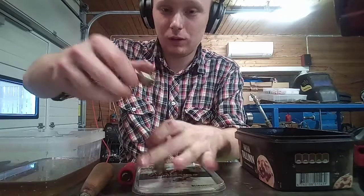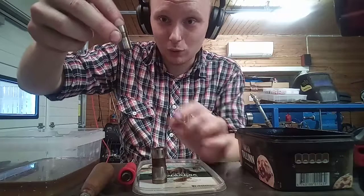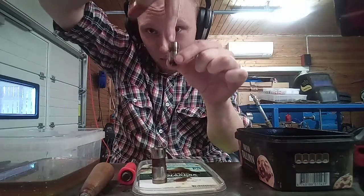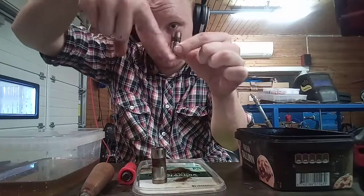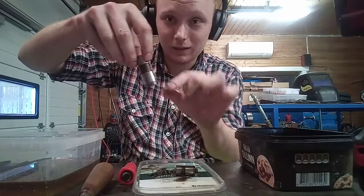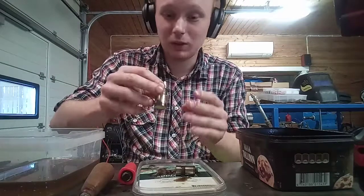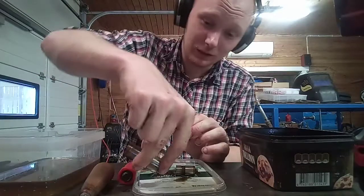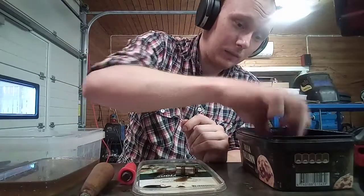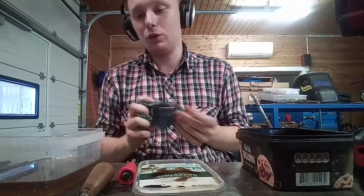The reason the air gun works is basically the same way it works within the car. At the bottom there's a one-way check valve with a ball and a spring. Pressing air up through here, it comes out through three holes at the bottom and into the sealed end of the cylinder, popping the piston out. Sometimes these can be hard to get out, sometimes they come easily, but this is my method.